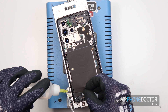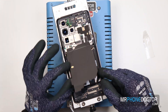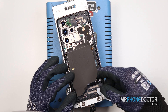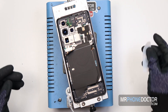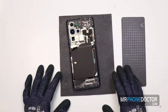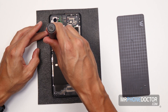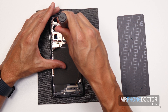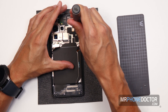I'm going to add a little bit of ISO 99 alcohol here. We have our QI charger here, which looks a lot nicer. I'm going to have to figure out how we're going to attach the flex cables for this tester — it looks like it's only got one attachment here, which is nice. I'm going to try to get to the power first, and I'm probably going to have to pull this QI charger to get to the power. We like to use little magnet mats here to keep all our little parts attached. I'm going to go ahead and remove this lower plate cover that's covering this charger. The screws are pretty much all the same size, so if you want to throw them all in a little pile, you can. The ones holding the logic board seem to be a different color — they're color-coded so you don't get them mixed up. Thank you, Samsung.